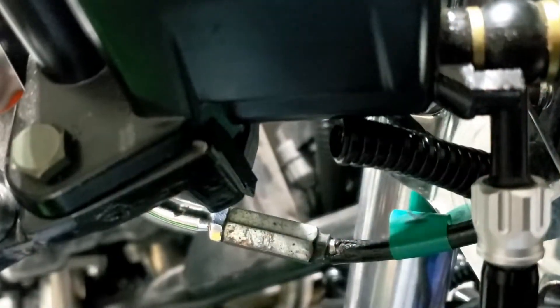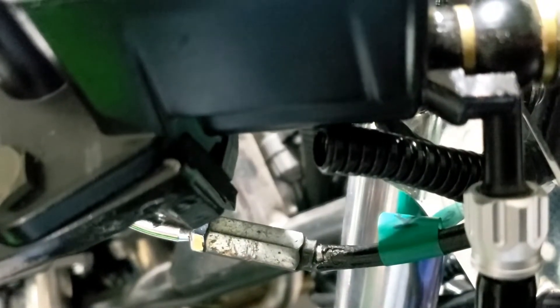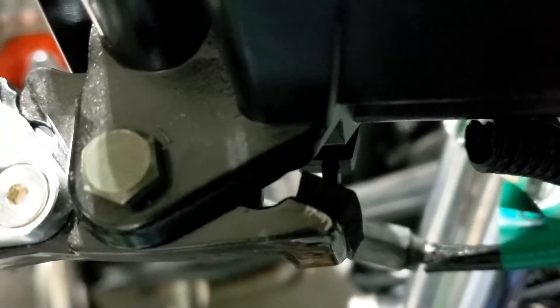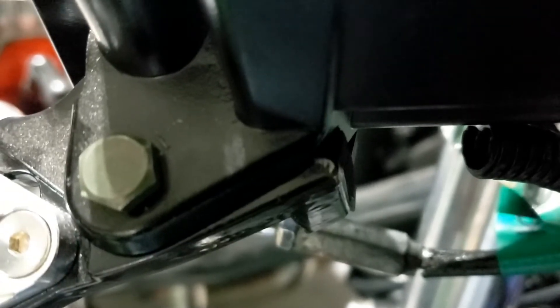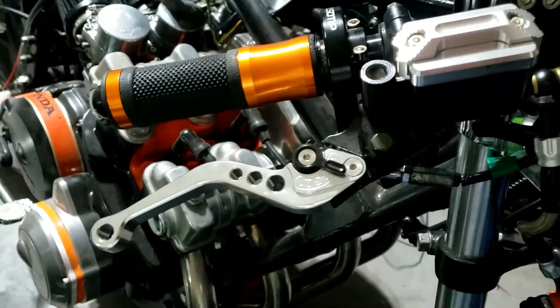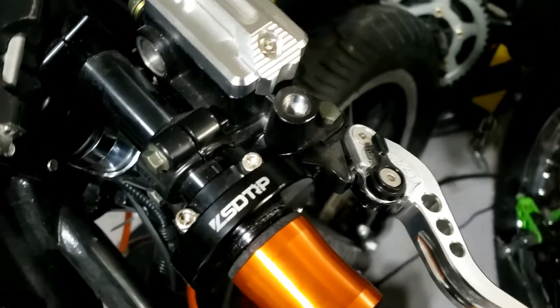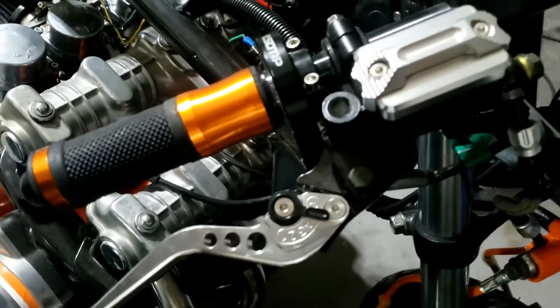The brake light was permanently on, so I thought it was some wiring gone astray. I rigged up some test stuff and it was none of the above - it was actually the switch on the lever. That little contact wasn't coming far enough back, so I've put some additional padding in there to hopefully push that switch off. Whilst I like these levers, this one is mucking me about a bit. With no fluid in the system at the moment that might push it out a little as well, but I think we've resolved that issue.